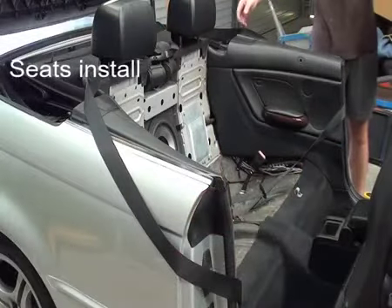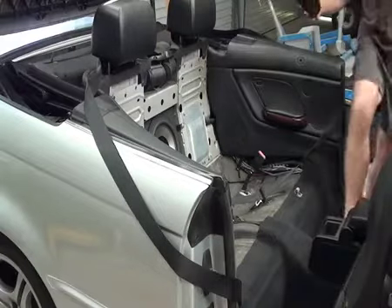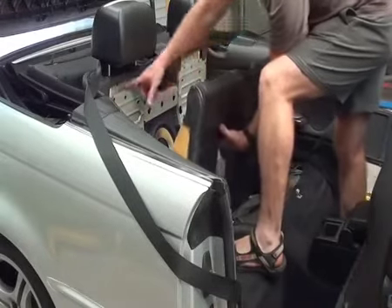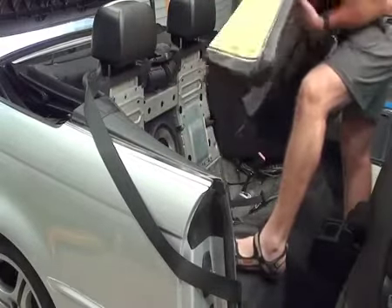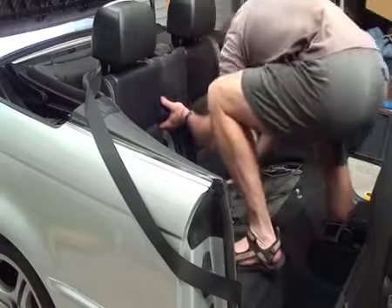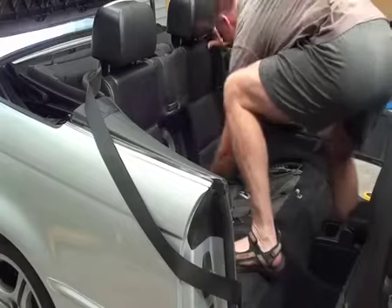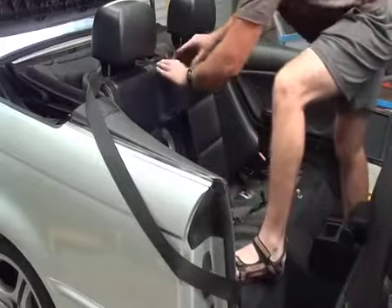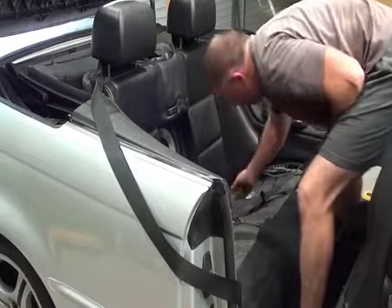Put the rear seat back in. Have the seatbelts around it like this just to keep them out of the way, otherwise it's a real pain. Then what we're going to do is the hooks on the back of the seat are going to go on here. At the same time, these at the bottom need to go over those screws that come out of the car floor. So we're just going to lift it up underneath so you push it in whilst doing that. Just look where they get threaded — so they go down to the hole, and the same on both sides. Then you can push that underneath there.